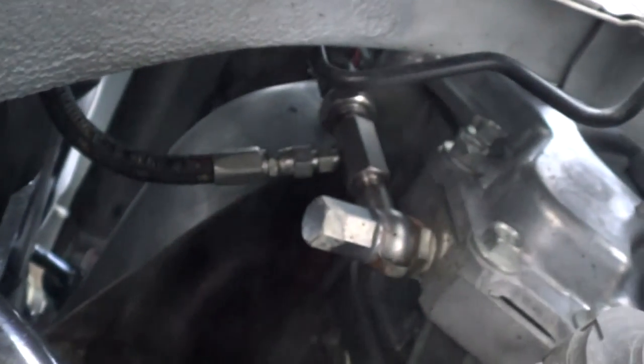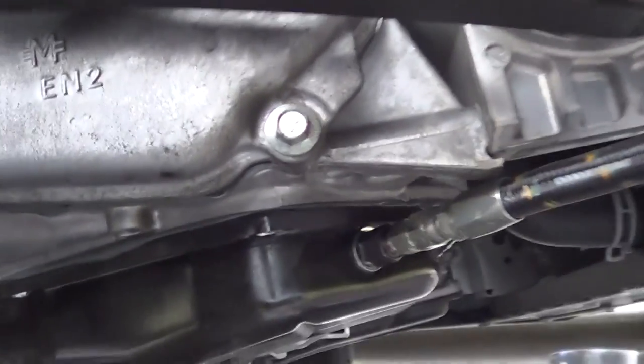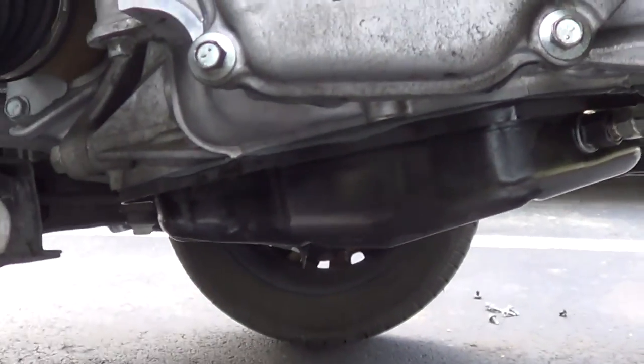You see the hose right there — it gets the full pressure from the oil. And it's a bypass, which means it just does a little trickle through it. And then it ends up going back into the pan. They recommend a little higher on the pan, but as you can see, I have a very shallow pan to start with.